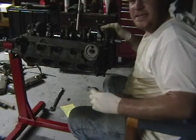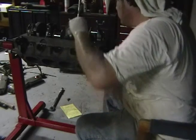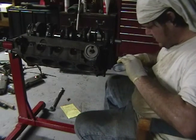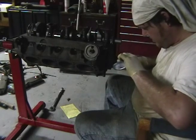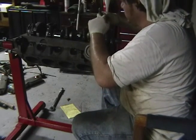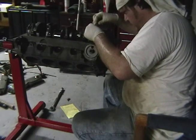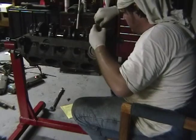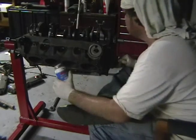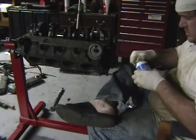I've got the piston all the way through. We're at BDC for the crankshaft. I've got a number on here. I'm going to put some assembly lube right here - I'm going to be pretty liberal with this because this is what gets spun when you don't have enough of it. I'll put that on and mix it around. I'm going to fit that right there and put a little bit of this stuff on - I put it on the main cap too, just a little bit.